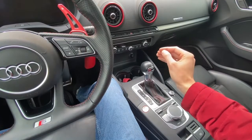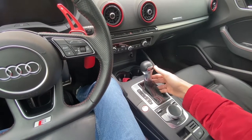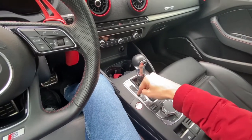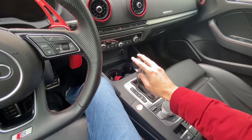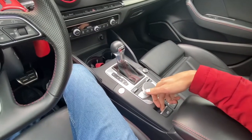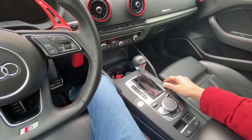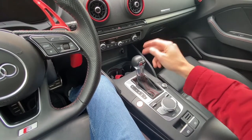There is a manual procedure that you can perform to shift this car from parked to neutral — for example, to tow it or put it on a flatbed. First thing you should do is check if the handbrake is on. If there's no electrical power, you should put something under the wheels just to make sure that the car will not move once you shift it from parked.